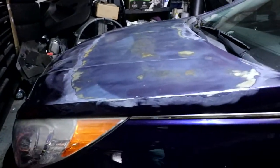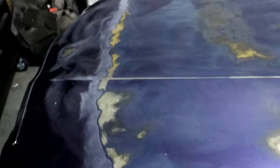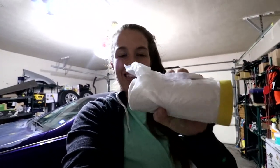We are back — it is currently Saturday. The car turned out pretty well; it's still a bit dusty so I'm going to wipe it down one more time. It is sanded down really well. We're doing the hood, the passenger mirror, and the trunk. The next steps before HP paints tonight: I'm going to mask off the car using this masking plastic that has tape built into it. We're just painting two big chunks of the car, which makes it easier. Then once masked, I'm going to prime it — it's important to prime where the metal is showing, otherwise the car will rust.